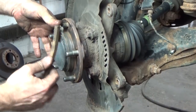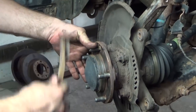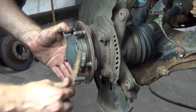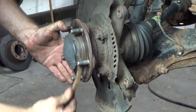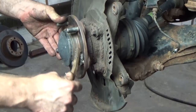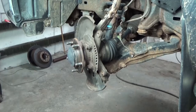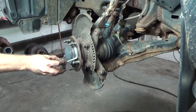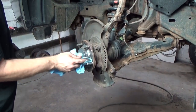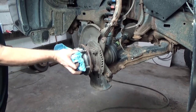To get in tight I have a few of these brushes — some coarse, some fine. This one happens to be a stainless brush for TIG welding; it's no longer going to ever be used for TIG welding. Just take and hit that perimeter. And I just like to take a little bit of never-seize, just a small amount, just a thin film — put it on there and wipe it back off.